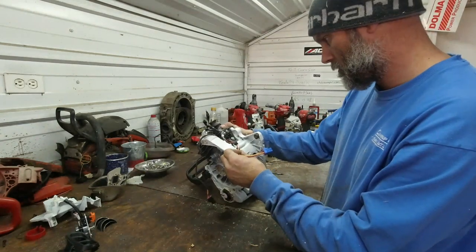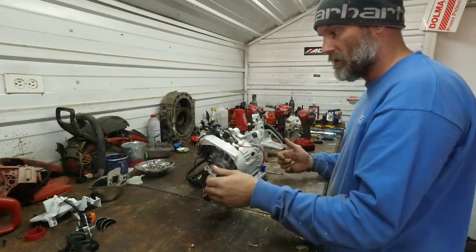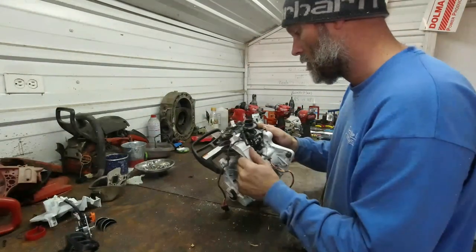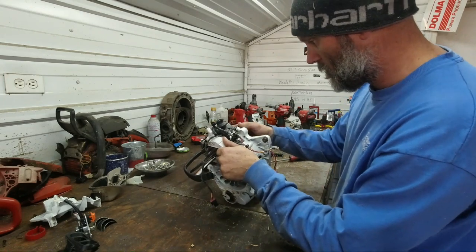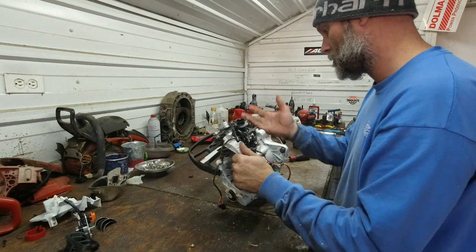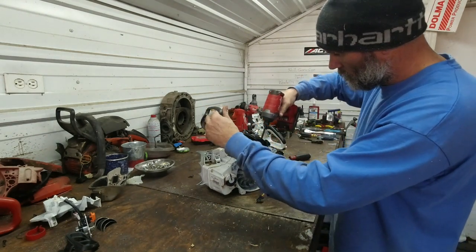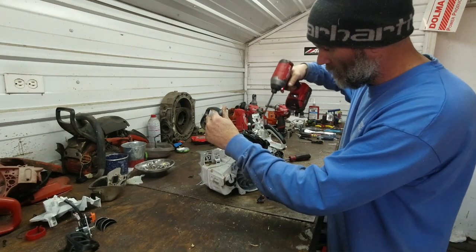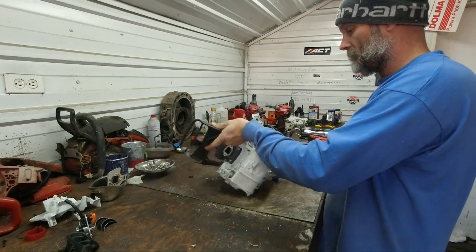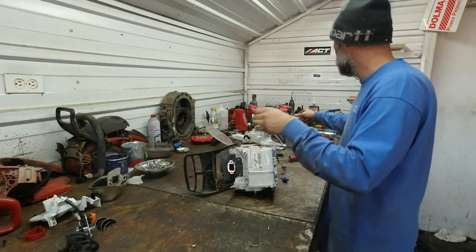I see no other harnesses going in. I'm also not seeing a, still not a throttle position sensor. I don't see one at all. There's three bolts right there. That one is released. I'm assuming at this point we can just pull the cylinder out. Before we get too far, we'll pop the flywheel off. 13.